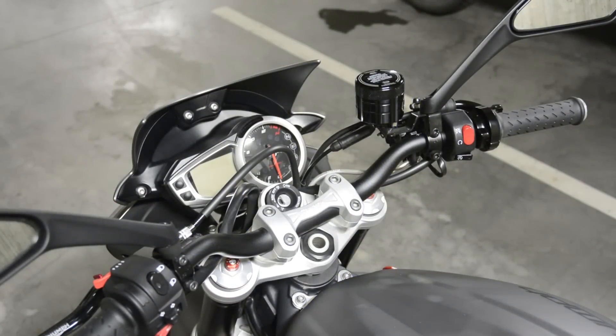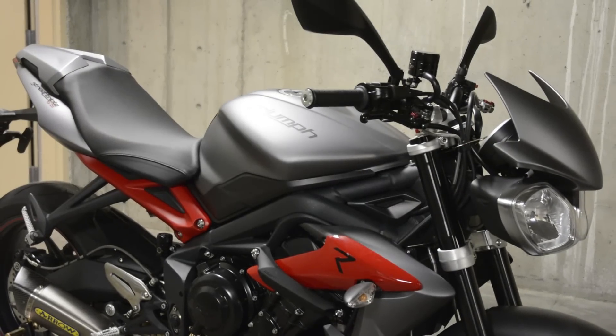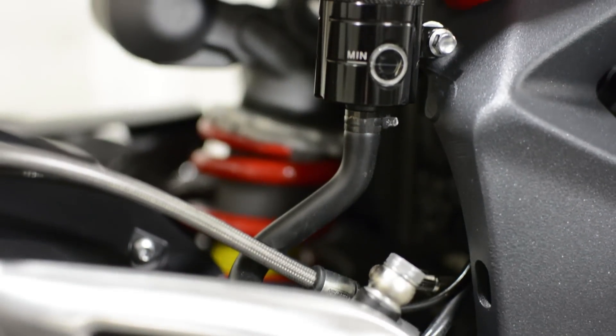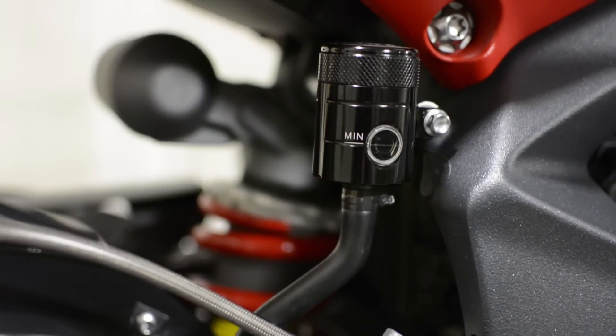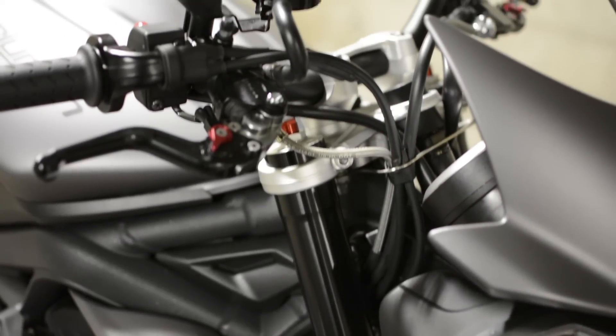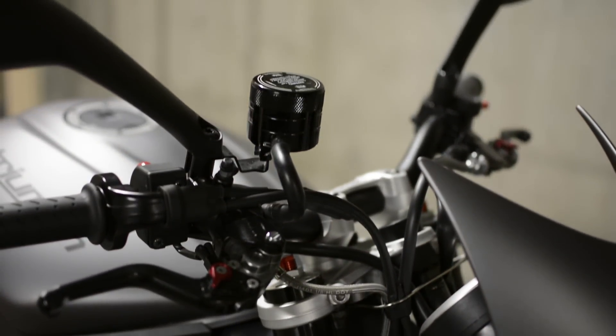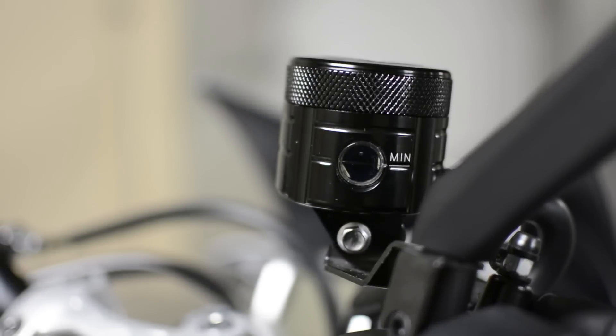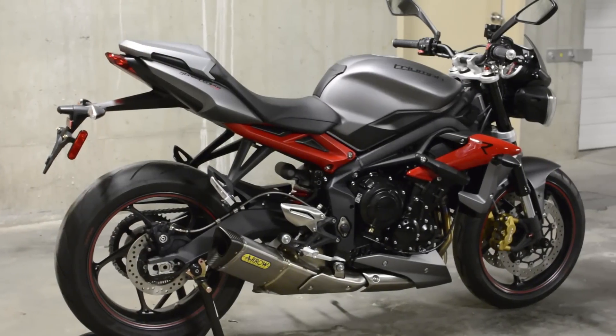And that's all there is to it. My brake fluid was fairly new so I didn't want to bleed my brakes. I also didn't need to bleed them because I drained them from the top, and it's also very unlikely that any air bubbles work their way past the master cylinder. These reservoirs look much nicer than the factory ones and have a lid that I feel is much more secure. I hope you enjoyed this how-to video — if you did, hit that like button and subscribe. Look out for more motorcycle how-to videos, product reviews, and moto vlogs. Thanks for watching.